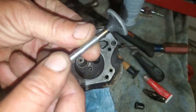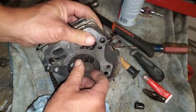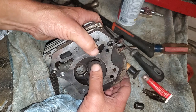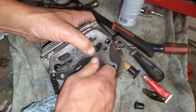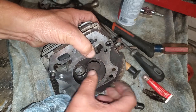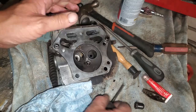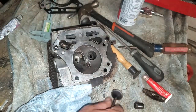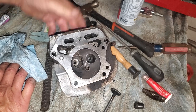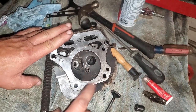I got a good mating surface on that against the exhaust seat — that is watertight now. And this is moving nice and easy back and forth, it'll open and close real good. Did the same thing on the intake valve. Going to decarbon this stuff — the intake valve kind of sucks too, it's got a lot of carbon buildup on it. I'm going to do that and show you how I get these back in.